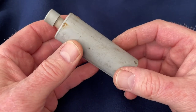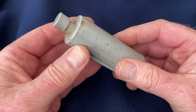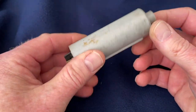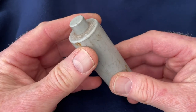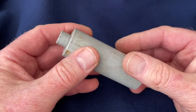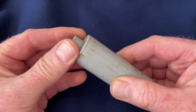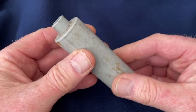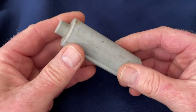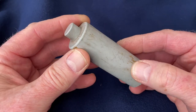I know there are modern equivalent kits available and I suspect we will not use this one in our Stag being rebuilt — we'll opt for a more modern electronic version. You can see them online; a number of UK suppliers sell them, so they're not as antiquated as this. Bear in mind this is almost 50 years old. The modern ones I've seen online also have a telltale light that goes into your dashboard so you can see if it trips. These old ones do trip on occasion and people wonder what's going on. I've also heard that people sometimes use these to cut off the fuel when working on carburettors, which I wouldn't necessarily recommend.